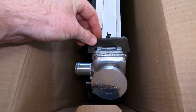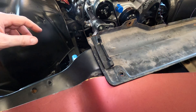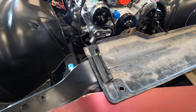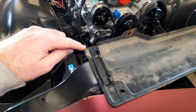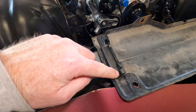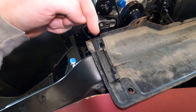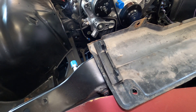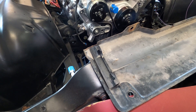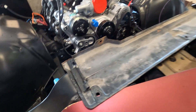And that's fine, as long as you know what you're doing and understand why. Here are our modified radiator support bushings — they're polyurethane and come in a similar but not identical shape to the factory rubber bushings. All the material where my finger is going has been trimmed off. This enables the part that's left to sit down on the inside of the tank on each side, holding it from moving left and right, forward, backward, or anything else you don't want it to do.